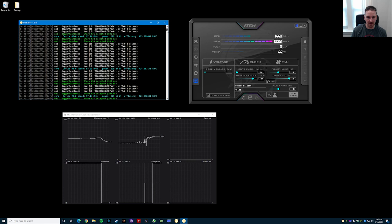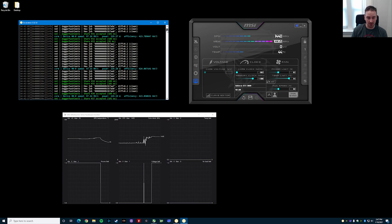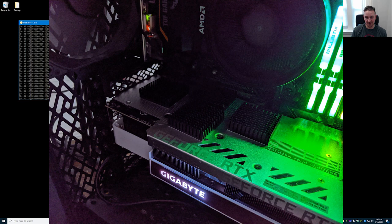Afterwards I could feel the back plate was so much hotter than it was before, which is good — it means it's doing its job dissipating heat to the back plate. I actually also put some small heat dissipation fins on the back plate just to see if that would help, and they get really hot, so I can't imagine it hurts. Hopefully this helps you out if you want to try it yourself — I think you should. I'll have links to the pads and stuff in the description. Big shout out to Red Panda Mining and Serpent YouTube channels that helped inspire me to do this. Hopefully this guide shows a more detailed breakdown of exactly what to do, the dimensions, and things. Thanks!